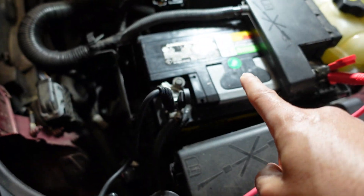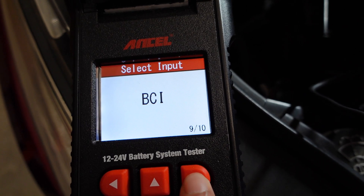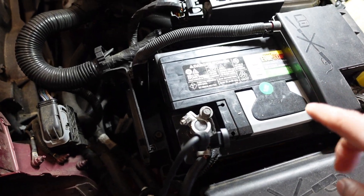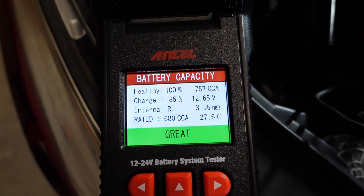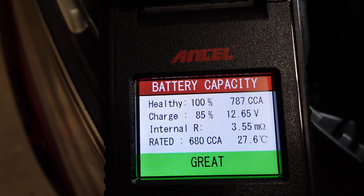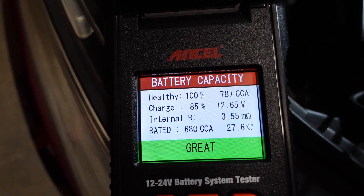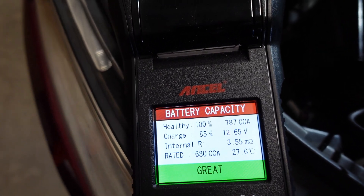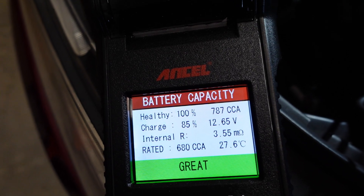Let's go back to battery capacity and hit okay. This battery is a regular flooded battery. We're going to go by cold cranking amps — you can see options 1 through 10 for multiple types of standards. We're going to do the typical cold cranking amps and hit enter. I think this battery has more than 680 CCA, but I'm using 680 just for this demonstration. We hit enter and it's testing — voila, you have a health report: 100% health, 85% charge, internal resistance 3.5, which is good. When resistance gets above five, particularly above six, you might want to get your battery replaced. You want to see something in the three-point range for internal resistance.